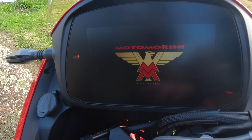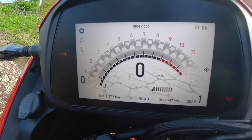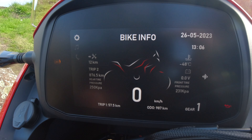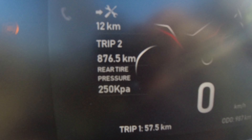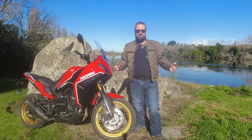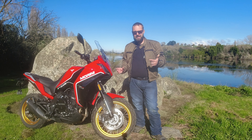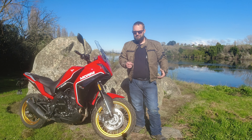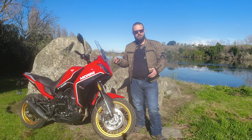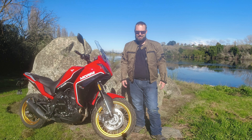The TFT on this bike is very cool and probably one of its biggest selling points alongside the switchable ABS. It doesn't have integrated maps, but it does have phone integration so you can control phone calls or music straight off the dashboard using the switchgear on the left handlebar — really intuitive, just open Bluetooth on your phone, connect to the bike, and you're done. One thing I've noted: if you're using an intercom like a Cardo, you can link it directly to the bike, but if your phone and Cardo are both connected before you turn the bike on, the phone will start trying to play music through the bike. The fix is just to click back to the Cardo, or turn the bike on first then turn on your Cardo.